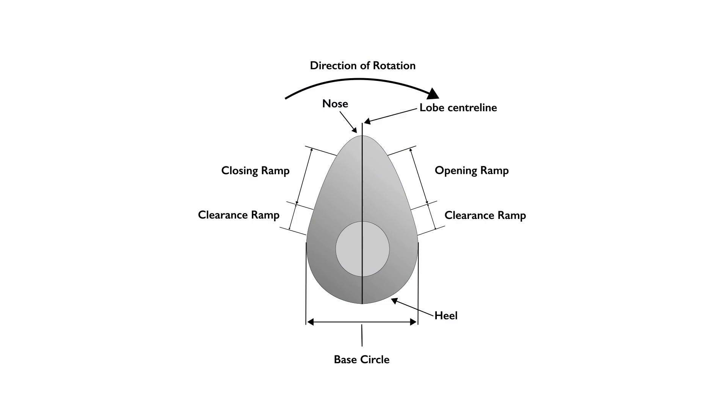A lot of people might think that you just measure the lobe of the cam and therefore that is your valve lift. But of course, with a rocker arrangement and some geometry changes, the lift and duration doesn't necessarily reflect what you're getting at the valve — and it's what's at the valve that actually counts. Just for those who aren't aware of the B58 engine, can you give us the two second rundown on the intermediary shaft that allows adjustment of valve lift and duration, and how that works?